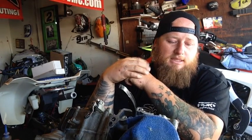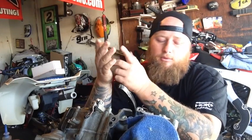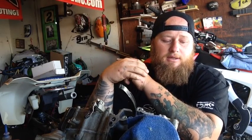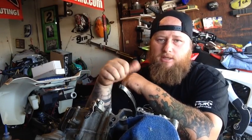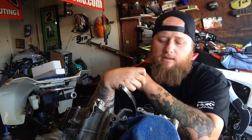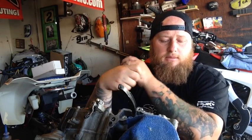If you can see three distinct angles on your valve seat, then you're probably okay just getting after it with some cleaner and a rag, getting any surface corrosion off of there. I wouldn't use any abrasives, like Scotch-Brite or anything like that, to rough the surface, because you can't do it evenly like that. Definitely stay away from lapping compounds, especially on a new valve. These things are treated and they have coatings on them, and that would just ruin the valve. So don't do that. Obviously, automotive is a different subject.